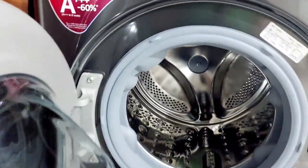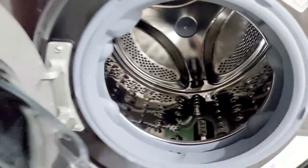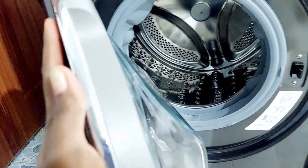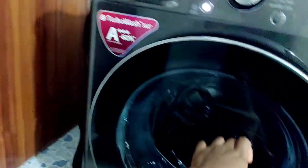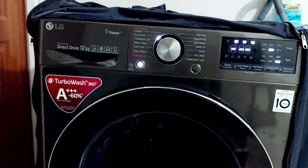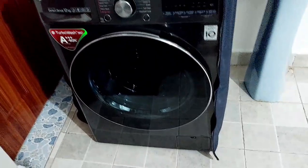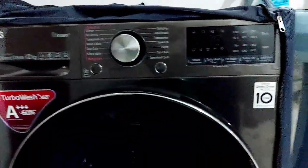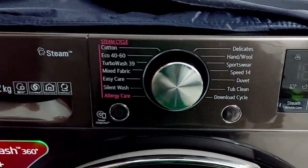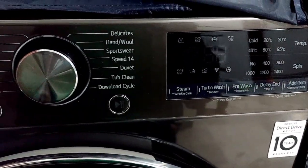Those are the main reasons we considered before purchasing the machine, and it has served us very well — I have no regrets. I also forgot to mention the tub clean option, which you can use to clean the machine monthly. For monthly cleaning, I add a little vinegar in the detergent dispenser and run the tub clean cycle. I also wipe the door and rubber gasket with a solution of water and vinegar. My previous video covered a deeper clean recommended every six months, but monthly I just use the tub clean option and it always leaves the machine smelling very fresh.